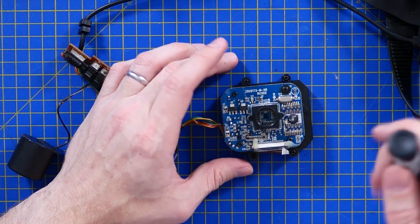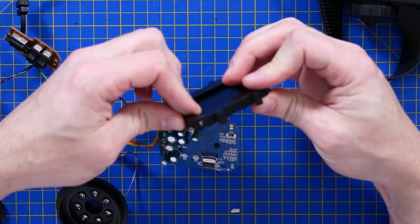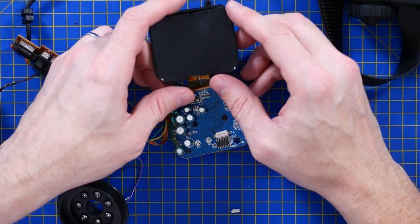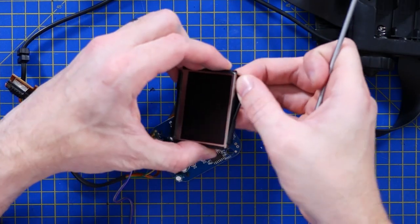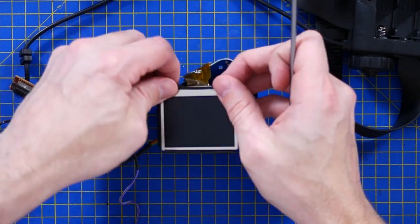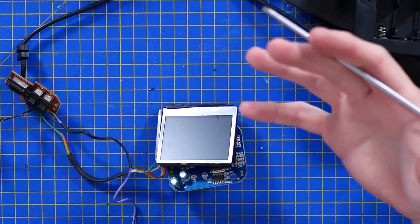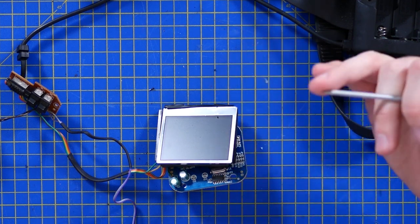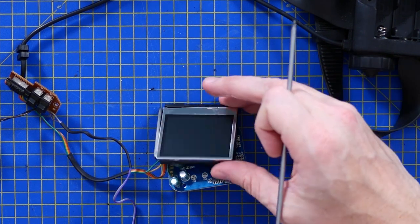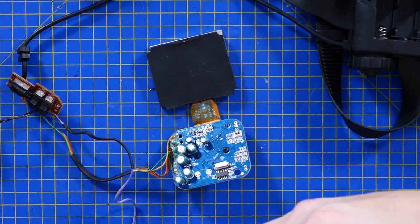They really glued the life out of that connector — I may even try and avoid taking that off. There's a rubber inlay around the whole screen. I think that rubber shroud is to help prevent light leakage from the backlight in the container — which is, for an overpriced toy, a bit over the top, but a nice touch all the same. You can see a part number on that screen. It's just an LCD — possibly the only differentiator from LCDs we've seen in camcorders is that this will have been LED-backlit rather than CFL, because these days the control circuitry for that is more cost-prohibitive than just having the LEDs.